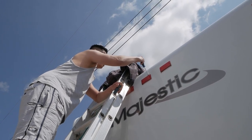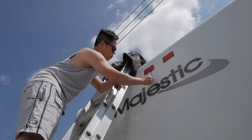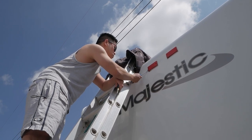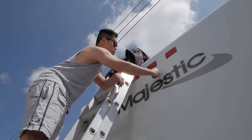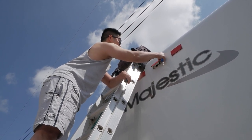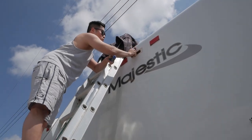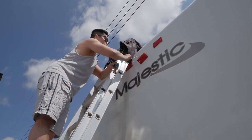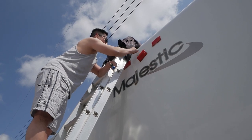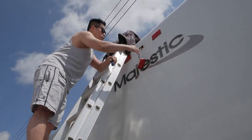There's adhesive in the back already so make sure you don't crack it. Try to use a prying tool because it can apply even pressure and get it out without cracking. If you crack it you've got to buy a new one — it's $42 for the light. The lights come in a whole fixture because they're LEDs, not like old-school ones where you just change a bulb. I pried it out nicely. I'm gonna take off the previous adhesive — before I put this back on I'll clean it out and put some sealant around here.